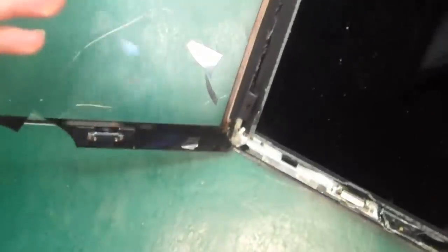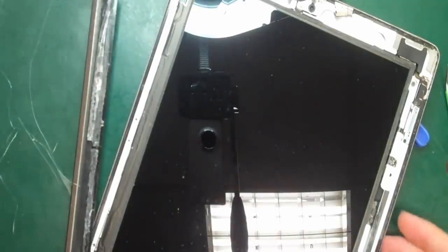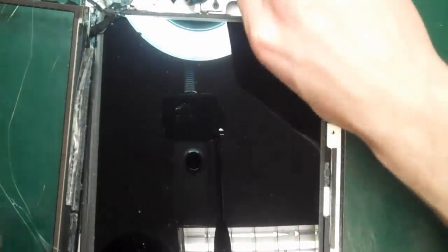Be quite cautious around the home button — too much pressure and pop goes the screen. I'd recommend using gloves. Also, the longer you take, the more the iPad cools down and the adhesive becomes effective again — so if you need to warm it up a little bit, do so. Once you can get any sort of lift, gently lift and open it like a book with the screen coming off to the left, because that's where the digitizer cable is. Hold the iPad down with a bit of pressure and gently peel the digitizer away from the adhesive.